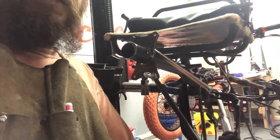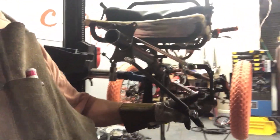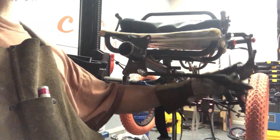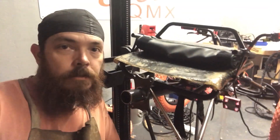When you're mocking things up, everybody knows you don't always fully attach it — sometimes it's just sitting there. With the shock removed, I can now demonstrate the suspension linkage. It's connected — tie rod, trailing arm. Just like all the new razors, it's going to have long travel suspension, about eight and a half inches when it's all said and done. Stay tuned.